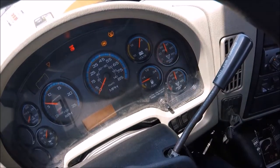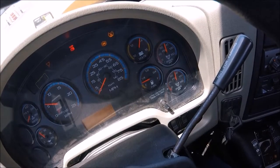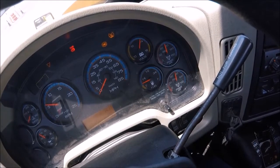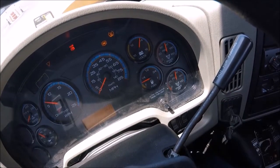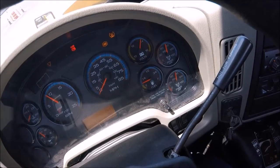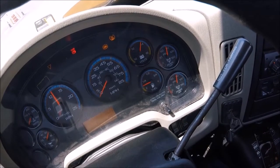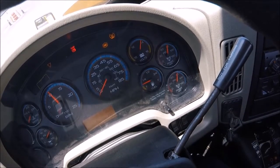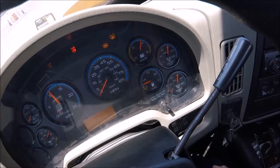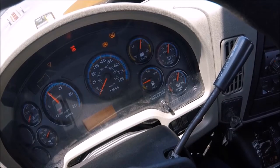About 75 PSI cut out, and typically they want to see it go from the cutoff to 85 to 100 PSI within 40 seconds, and typically you're idled up to about 1100 or so. Even with it just at basic idle, it still climbed up to the 85 to 100 mark in under 40 seconds.